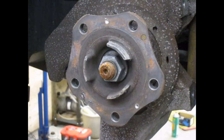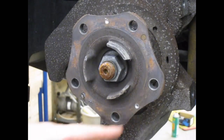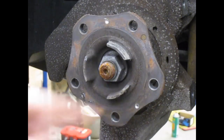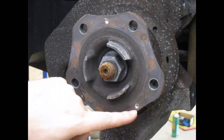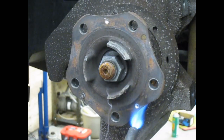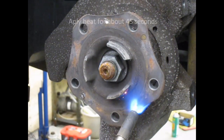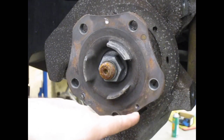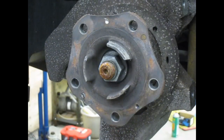Now I've taken off the brake rotor, so I can address these two broken bolts — the ones we had to drill out. Now that the rotor is off, we can see we're right by the edge of the hub. The first thing I'm going to do is apply a little heat to the area — not a whole lot of heat; I don't want to burn the grease in the bearing. Just enough so the metal will start to expand a little and maybe break some of the corrosion bond between the threads and the bolt. You can also still see the little hole in the middle from my center drill, which will help me continue drilling straight through without nicking the threads. I've heated it just to the point where the shiny metal from the drilling has now been discolored — it's kind of brownish-gold right now. That's hot enough.